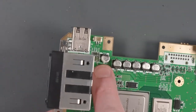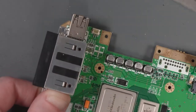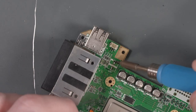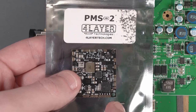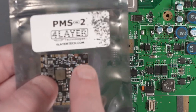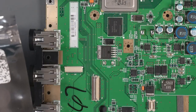There is also this 1.8-volt voltage regulator that we have to remove. The PMS2 has a 1.8-volt voltage regulator on it, so we don't need the one on the board. However, if you have a PMS Lite, you have to keep the voltage regulator here because the PMS Lite does not have a 1.8-volt voltage regulator.